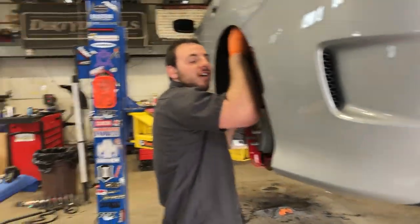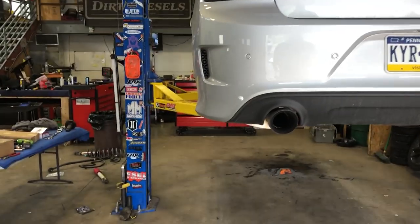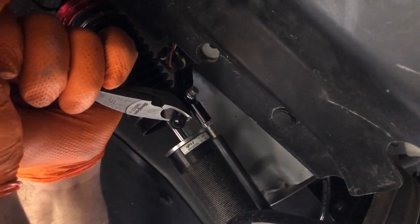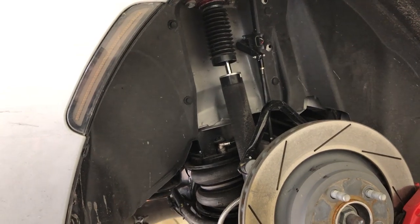Doing what we just said looks like it's going to work — it's not hitting at all. We are a little bit bigger so we might have to adjust some of the airlift settings. We might also need to adjust some of the fender liner — you could probably just cut where the ridge is. These arms are sort of universal, so they're meant to do that. If you had to go up to the very top hole, you can cut it and shorten it — they're trying to make it a universal fit for all vehicles.